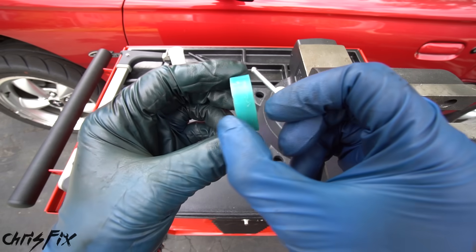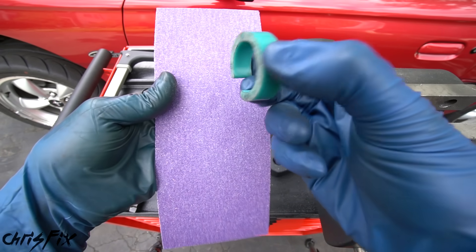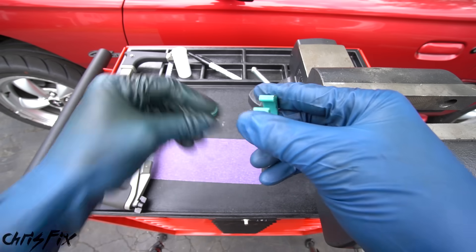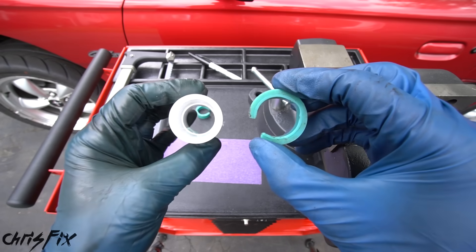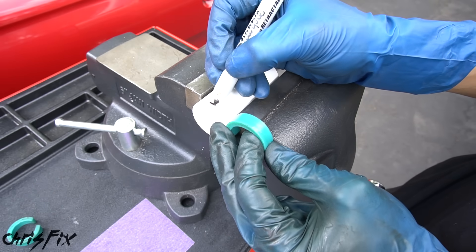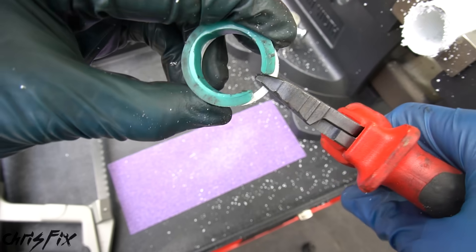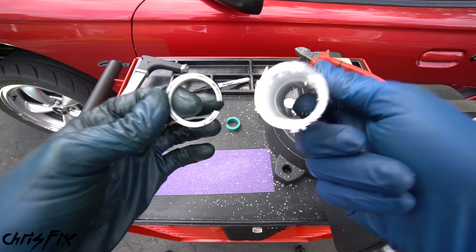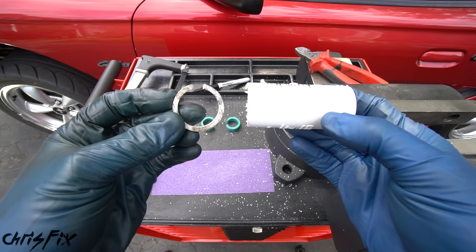The first reasonable way is to shave down your rack limiters — maybe to half their size — using a belt sander, sandpaper, or a vise and saw. If you want to keep your stock rack limiters, another option is to go to a hardware or plumbing supply store and get some PVC pipe. It fits perfectly, so you can cut your own rack limiters: put it in a vise, measure out half the width of the stock limiter, cut your piece, cut the C-shaped slots, and it's ready to install. It's a cheap mod that gets you a couple more degrees of angle.